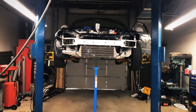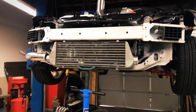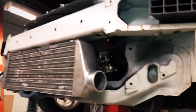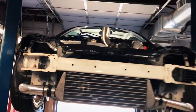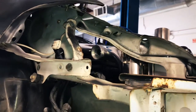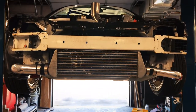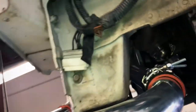We've got some of the intercooler piping on and right now I'm mocking up the intercooler. We're going to mount the intercooler and then continue on the rest of the cold-side plumbing to the turbo. Our intercooler piping is now complete — starting at the throttle body, coming out we need to install our blow-off valve, it makes a sharp turn down and out to the front to the intercooler, and that's where it all begins.